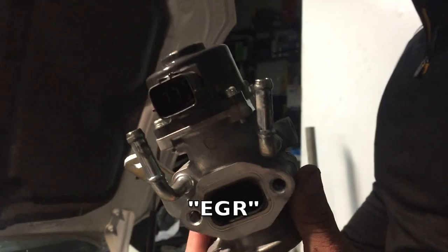The car has turned on. Danny's gonna go get a tune tomorrow. It's really a good idea to wait — actually it's recommended. You should have a new tune for TGV deletes, EGR deletes, and new charge piping. Realistically you should always get tuned. The FA20 is a really sensitive motor — Cobb is really just meant for you to be able to drive and break in. At the end of the day you should always be getting tuned no matter what you do.